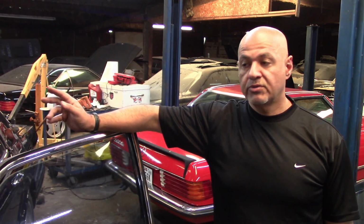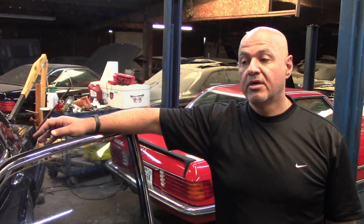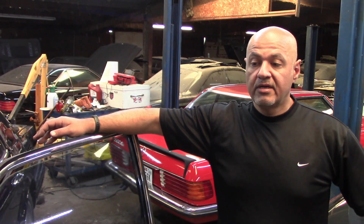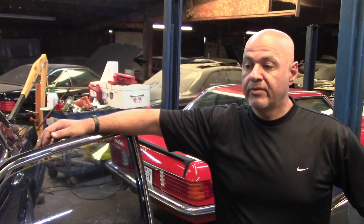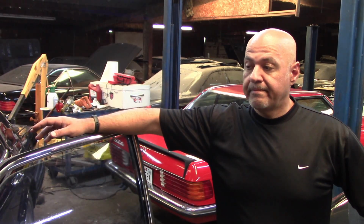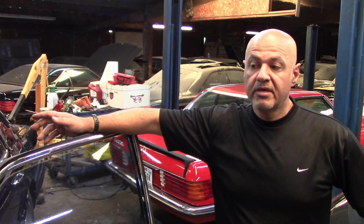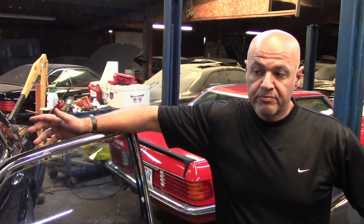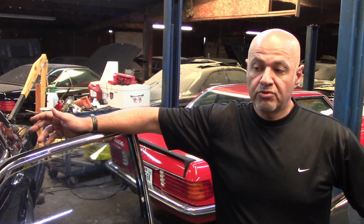Turbo R, and I was getting a similar result until I started the engine up. When I started the engine up, the O2 sensor readings dropped down to 0.45 volts, which is right in the middle of where it needs to be. I think that's pretty much where it's supposed to be. I plugged it back into the Brooklands, cranked it up again, it read the same. But the engine still runs pretty rough, so I'm trying to figure out what the story is there.